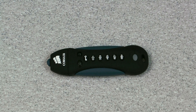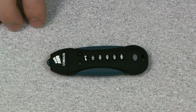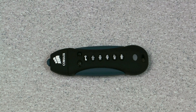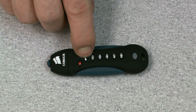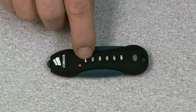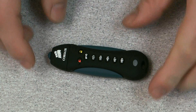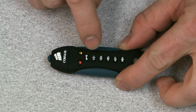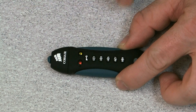The Padlock 2 will function just like any other regular flash drive until you've set a personal identification number, or PIN number, and we'll show you how to set that PIN. The first step is to hold the key at the top of the drive for three seconds, and you'll see that both red and green LEDs will illuminate. Then you want to enter your desired PIN number — you can use any combination of numbers between four and ten digits long, so we'll just do 0-1-2-3-4.